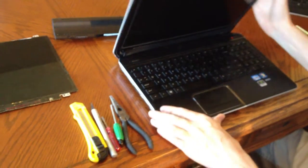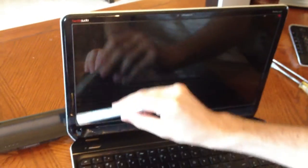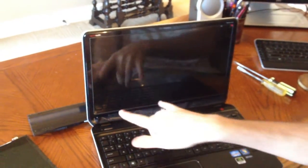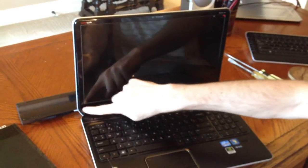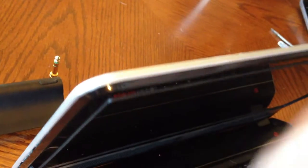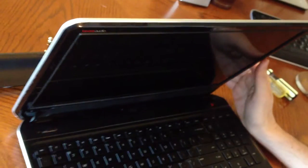This is the hardest and first step in the process. If you look on the screen, you see a gray and a black layer. This is actually the frame that covers the screen — this is what the screen looks like, and this is just an aesthetic plastic part that you're going to have to take off. You're going to have to know there are four hidden screws you need to take out under this grill, which actually will come off. The hardest part is going to be removing the black plastic piece from the gray piece — you can get between them, and it's connected by tens of clips all around it. So start from the corners, work your way around, and then try to take it apart.